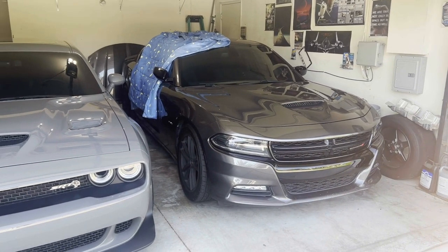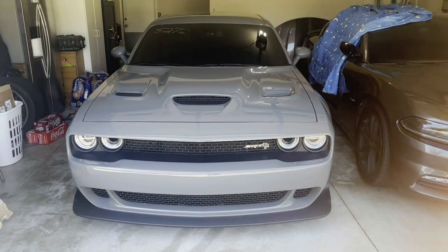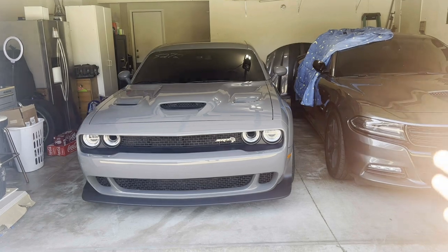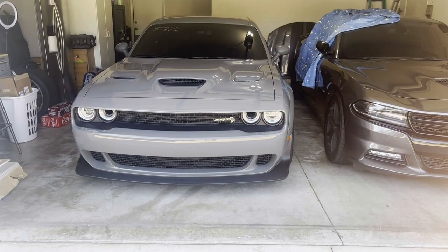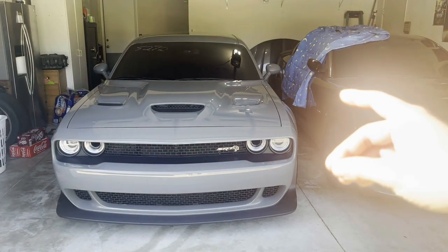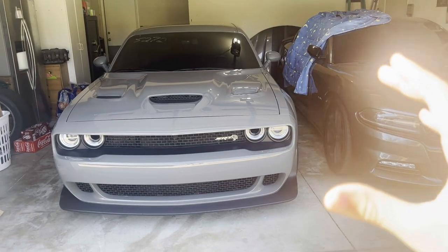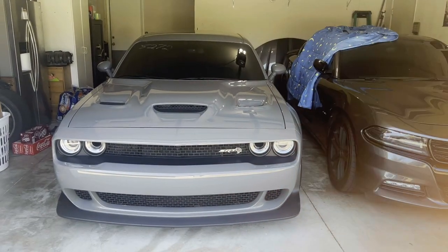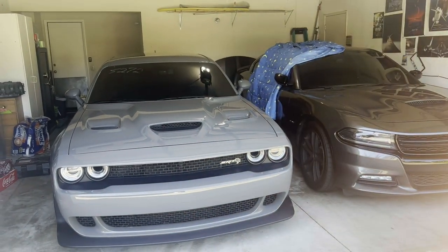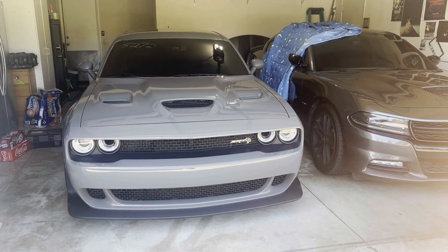If this video wasn't detailed enough, check out my channel for another video on the same topic with a different car. This process is identical for Chargers and Challengers. For the newer Dodge cars — 2015 and forward — you don't have to tune for this gearing change. I went from a 2.62 to a 3.09 on both cars without needing a tune. With Hellcats, the 3.09 can bring up early shifts faster and you might hit the rev limiter, but to drive the car out of the shop you don't need a tune. For WHP pulls, some people do need a tune, especially higher horsepower cars with super small pulleys that might sneak up on the one-to-two and two-to-three shifts.